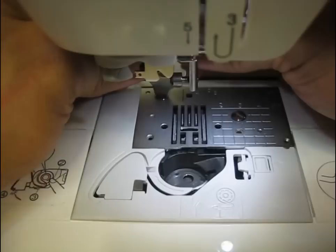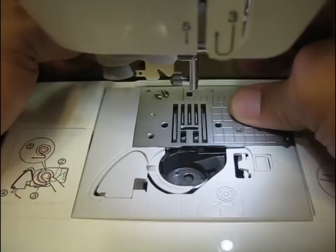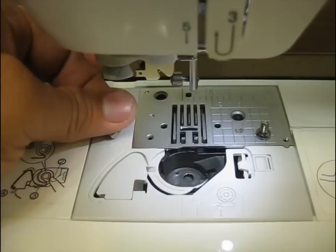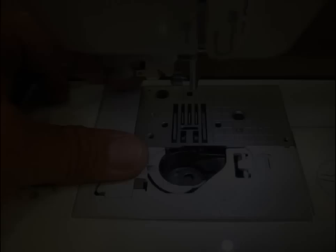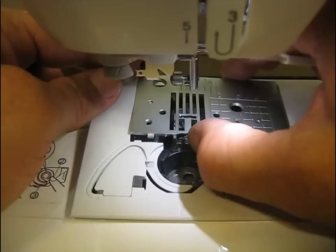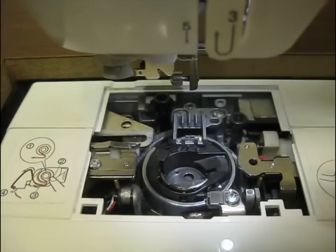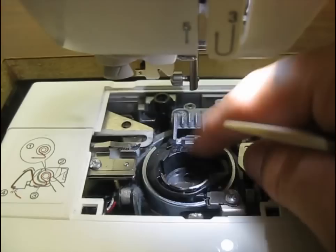You can use a dime — that will work great. Just loosen up these two screws right here, then spin them out using your thumb. Put those someplace safe so you don't lose them. This is going to allow us to take off the needle plate, which is this metal piece right here, as well as the plastic piece which is the needle plate cover. You can just pop this off — it's two parts but they're joined together with some tabs underneath. It'll take a little doing; don't force it, it'll come out freely.